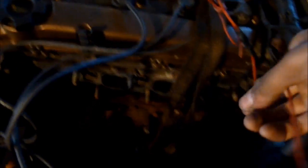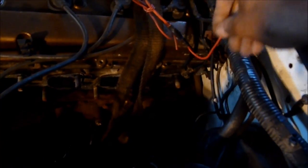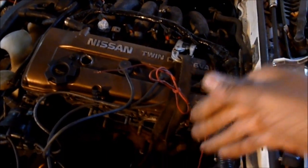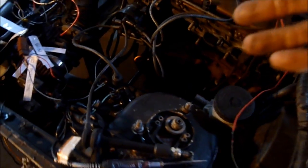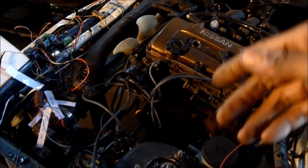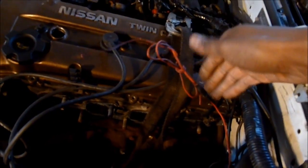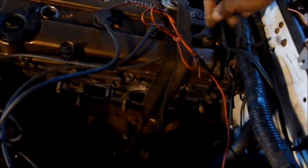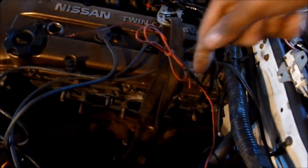Right here I grounded it right to the engine. This wire turns from green — soldered and shrink-wrapped — so it's a pretty good connection. These extra red wires are just extra grounds. I had it grounded to the body and wasn't getting any spark, but ground it to the engine and now I have spark. Hopefully that fixes your issue too.